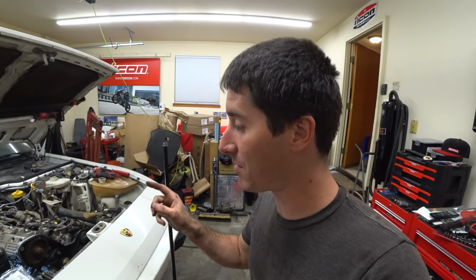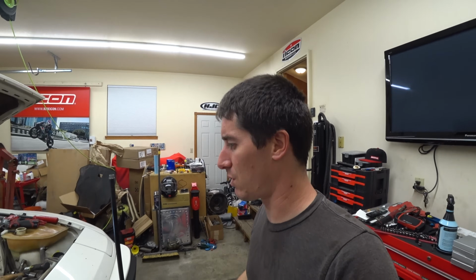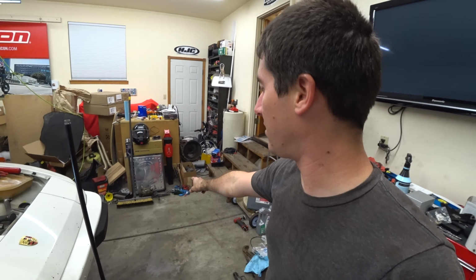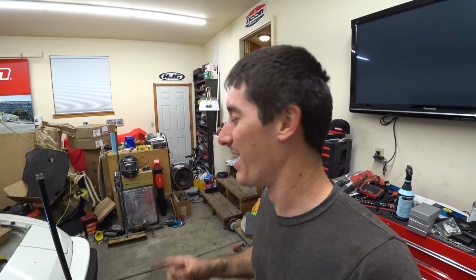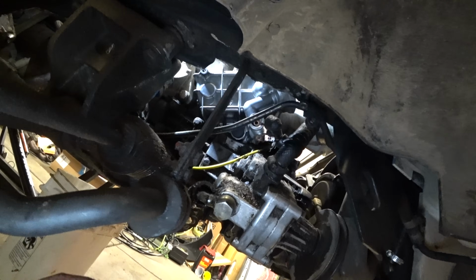So now it's time to get back down below and pull out the oil pressure relief valve positioning tool, I think is what we would call that. I should have taken that with me and cleaned it, but I gotta clean the relief valve there, but we're ready to install it. I'll just clean it with brake clean and a rag, but it would have been nice to use the parts washer.